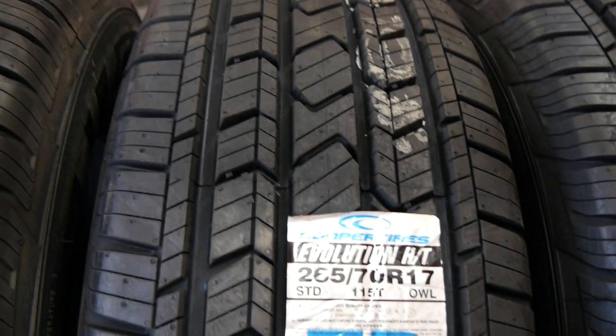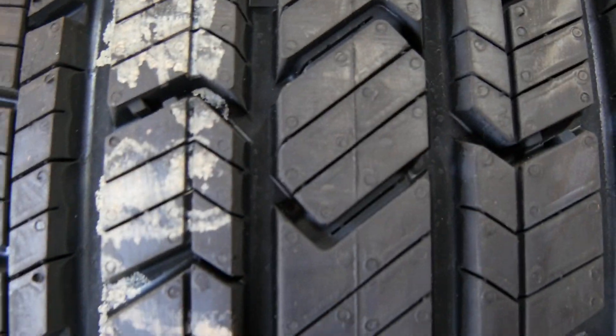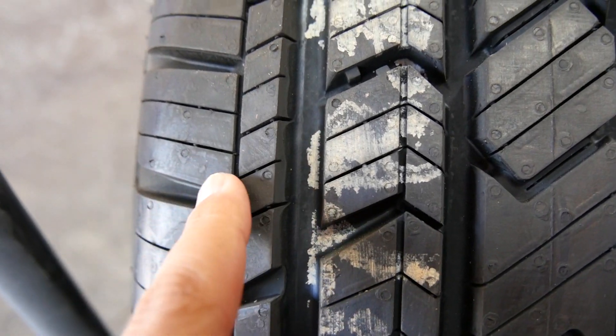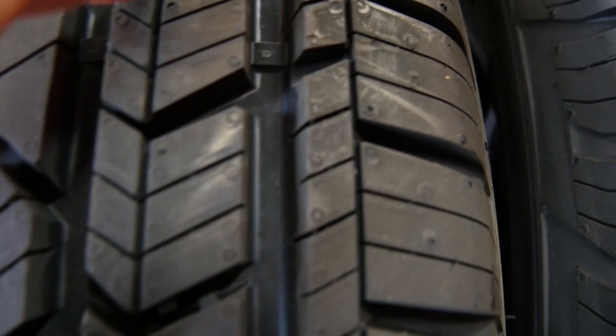The tire has directional grooves that crisscross each other, which cuts down road noise and helps shake out dust, dirt, vibration, snow, or whatever you may encounter. It's got sipes going through all the tread blocks for great water dissipation, open shoulders on every three blocks, big open channels, and wear bars well down below. You can also see these small rubber pieces sticking out periodically — those aren't mold artifacts, they actually help cancel road noise.